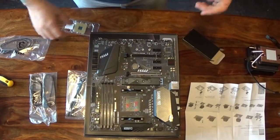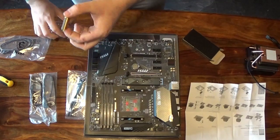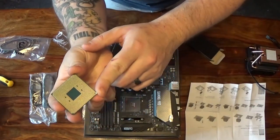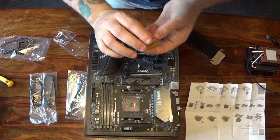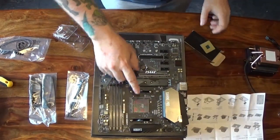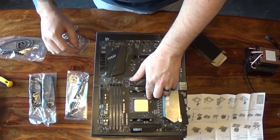Now we shall be putting the CPU onto the motherboard. Do your best not to touch the panel at the bottom — you don't want to damage anything. You'll see on the CPU there's a little triangle, and there's a little circle on the motherboard. You want to try and line those two up without touching too much of it. First, you'll have a wee leg — click that up. Once you've clicked that up, align the arm to the circle. It should just click into place, then snap that back down.